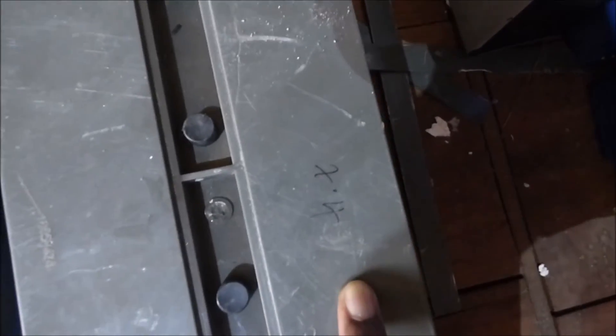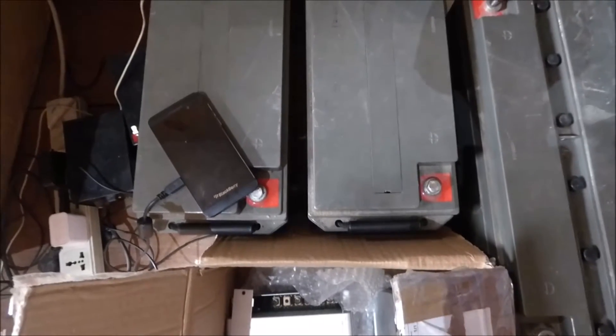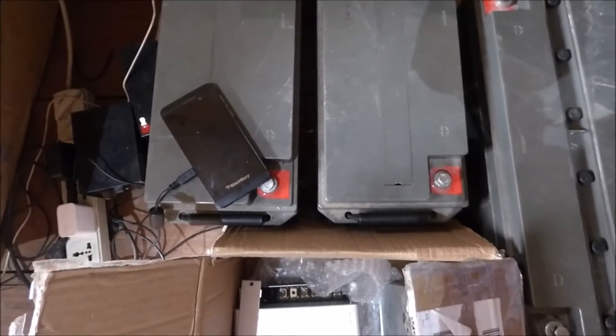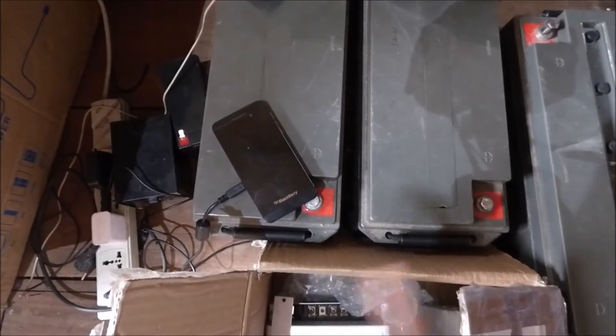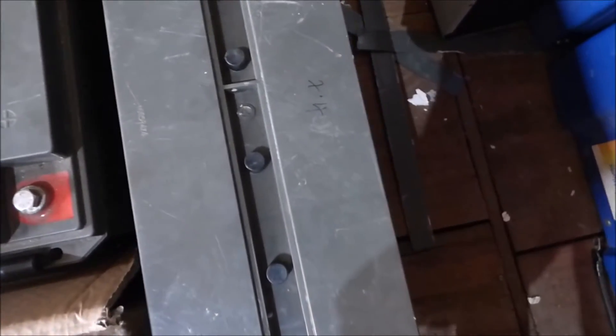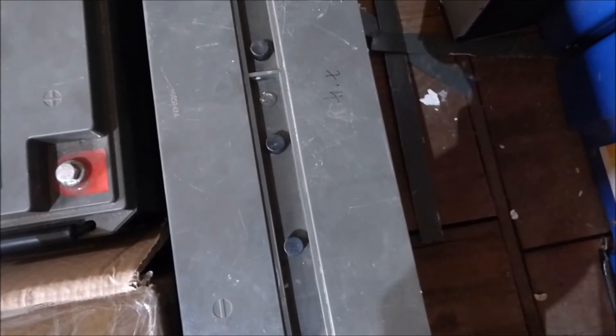We have similar experience with other batteries here as well. This battery was at 7.4 volts, and these batteries — even though they were at 12 volts — when you put a load on them they crashed. Now these two can manage a load and stay above 12 volts. This one, however, will fall to 11 volts under some hot loads, so we may need to run the desulfator a little longer and charge it more to see if we can rescue it.